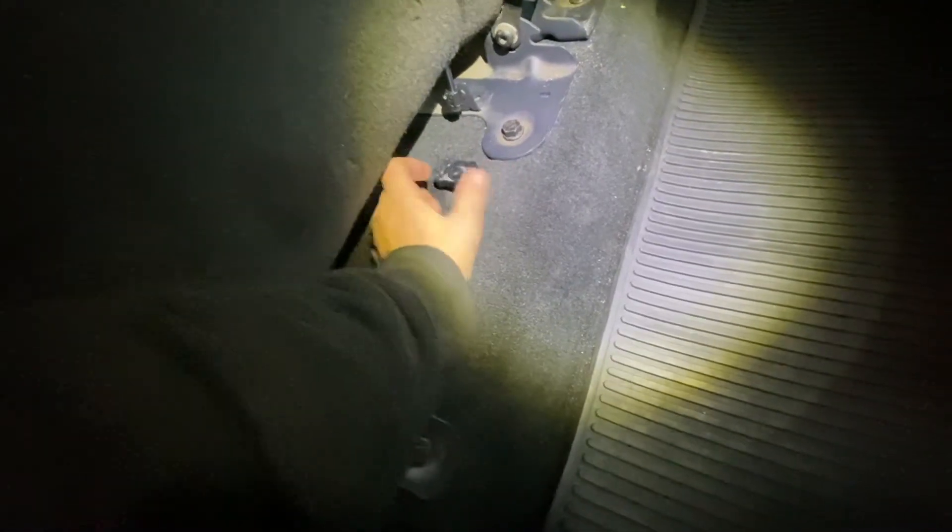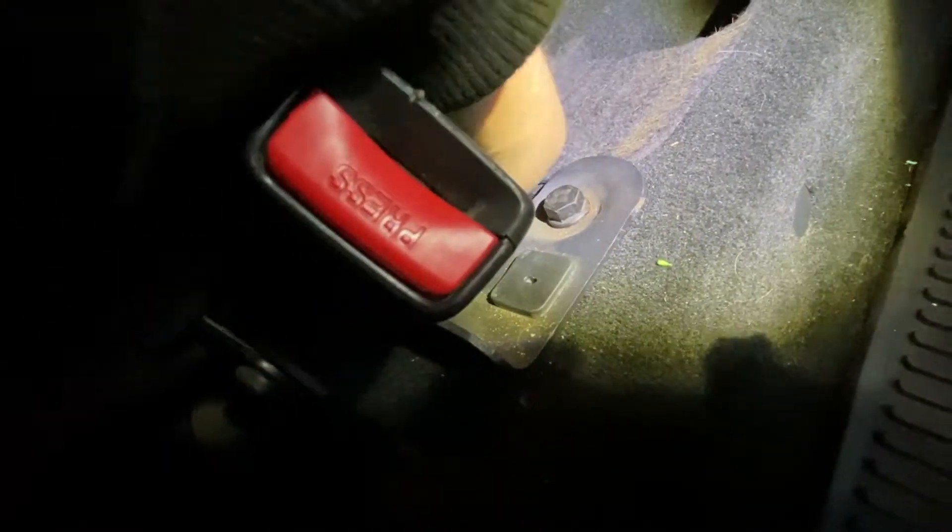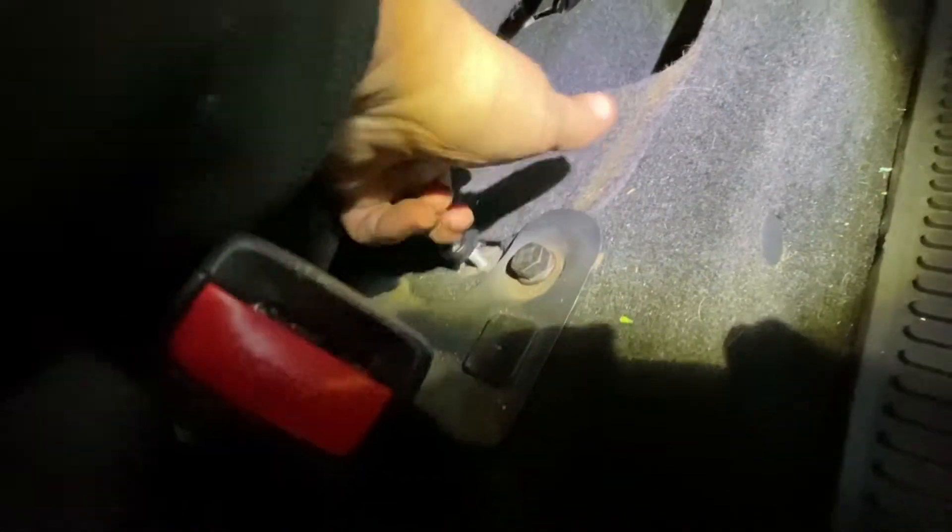On the Super Crew — that's the cab with the double doors — you're gonna lift up the seats and you see over here you have a bolt. You unscrew that, and it's good if you're buying a truck like this to make sure that it has the little jack kit, because they're expensive. You take that one out and there's one on the other side. Basically they hold it in place with friction.